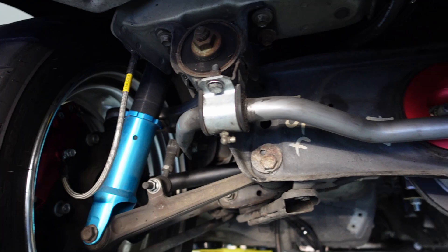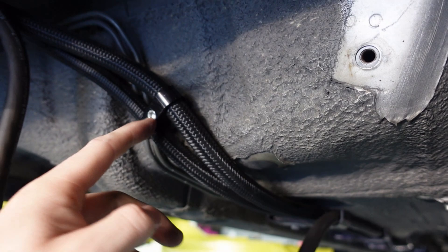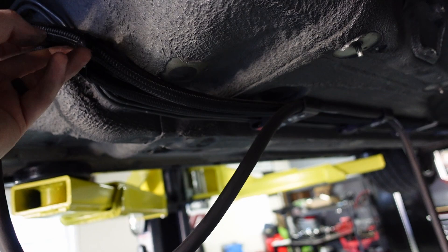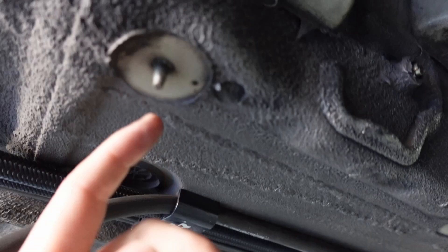You get the Ford 88 in there. So you can see the fuel lines — I made these little brackets here too. Drilled these out the whole way through; they're not designed to go all the way through, so I drilled them out on the backside so it could hold fuel line the whole way up. Used to have zip ties, but I think this looks better. The only place I have zip ties now is up here at the very top, because I made one of these brackets back here too. I think it looks nicer — it gives me peace of mind that it's not rubbing against each other. Taking these out, got to undo these little plastic nuts. I wish this would have been a bolt up inside the chassis and not these. They have a stud that comes out with almost like a screw-style thread — literally like a screw. You use these stupid plastic clips. I have four or five extra because I've broken so many over the years.